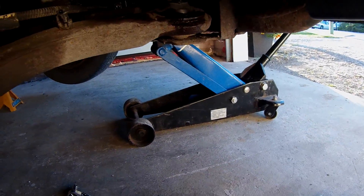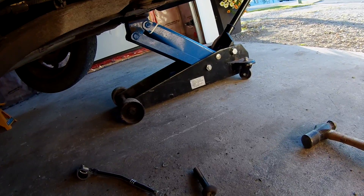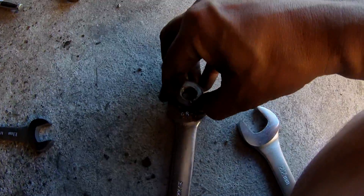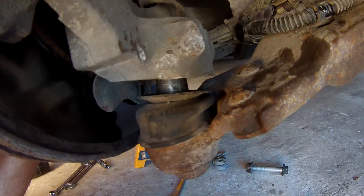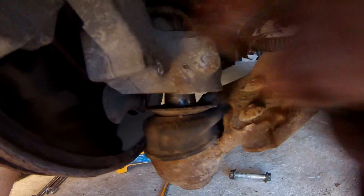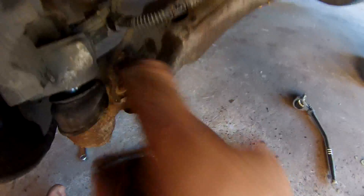I got this bolt out — it's a T55. This was a 20, 21 I think. It's 21 over here, 21 on this side and 18 on this side. I've got all this unclipped. I'm just going to have to get something to pop that little clip out. You can see this is already separated and that's off — that should just fall right out. Then we can get started on these rivets here.